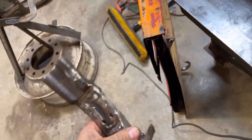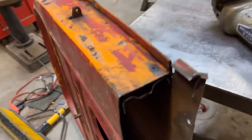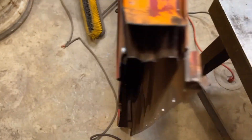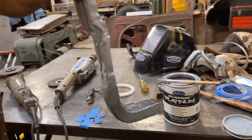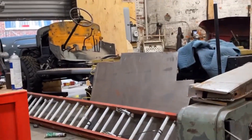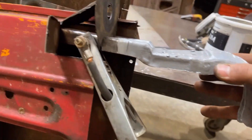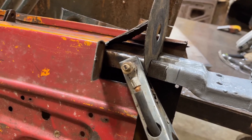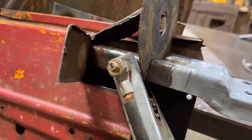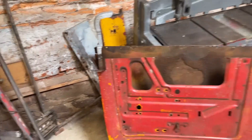I'm going to pull back a little bit of the sheet metal and create a little peekaboo opening in here so I can readily weld this piece back into place. That should facilitate welding. Looking at that Eastwood Rust Encapsulator — stuff is fabulous. They use this on the entire frame of the truck; check out that video if you haven't seen it already. Metal's dry enough. I've never seen anybody do this before, but it seems like a valid idea — I cut this off with a cutoff disc, so why not use a cutoff disc as a spacer to set the gap so everything lines up perfectly when I put it all back together. Time to get welding. One door with its structural member, securely fastened. Moving on.